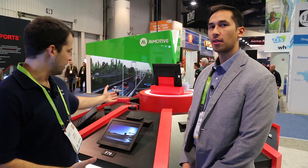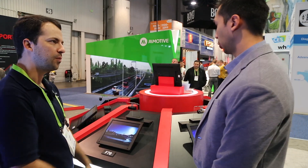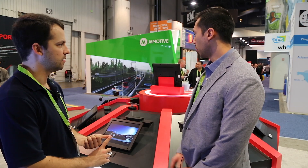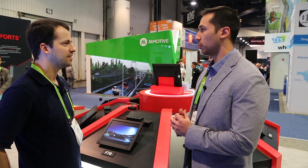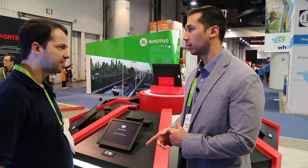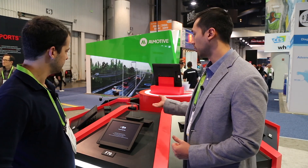Taking a look at the two new dash cams — we've got the new F70, which is the successor to the F50, and then we've also got the F200, which is kind of the evolution of the F100. The F70 will be the big brother of the F50, replacing it with a new casing and a new design, slightly glossier. It will have the Ambarella A12 chip, a new image sensor — we're using a Sony Exmor image sensor — so we'll be able to get better image and video quality than the F50 did. It also has an energy saving parking mode, so if you want to record longer durations, we do have that feature on the F70.